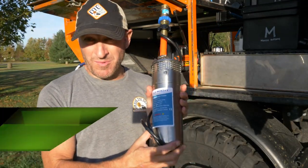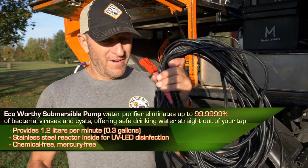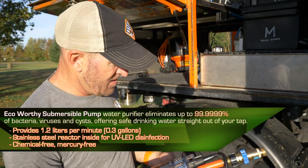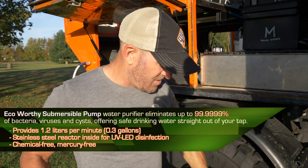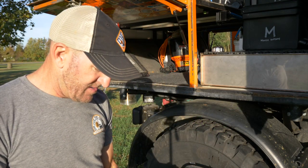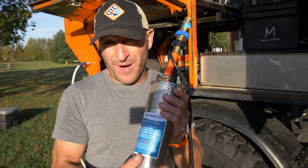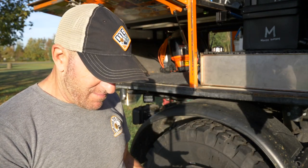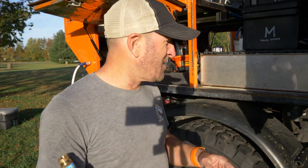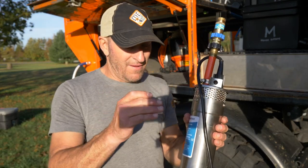For drawing from a stream, river, or body of water, I have a submersible pump on board. It's a 24-volt pump, and I've got about 100 feet of cord with an Anderson plug on the end that plugs into an outlet on the vehicle. The pump uses 5 amps and can pull water up 230 feet — it's pretty powerful. I've tested it at about 50 to 60 feet away and it's worked flawlessly. It pumps about 3 to 4 gallons a minute, so filling an 80-gallon tank doesn't take long.